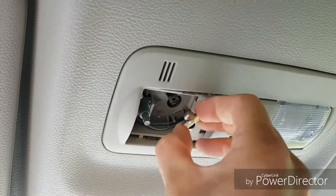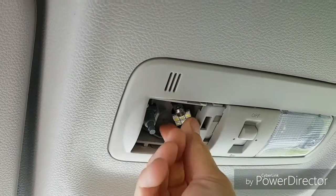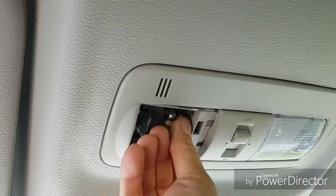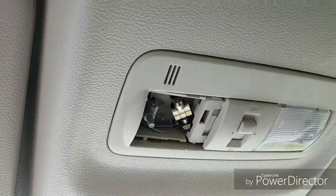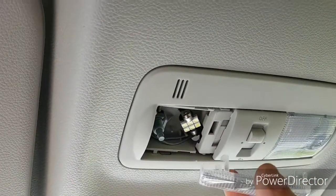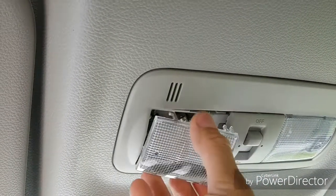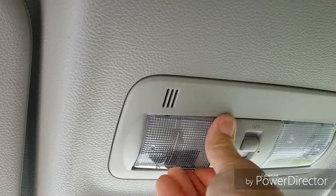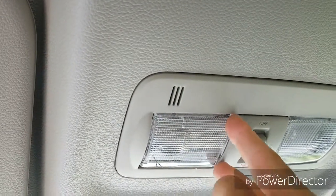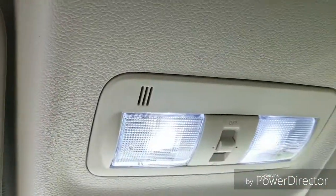That's right. So simply reinsert the festoon bulb, angle it basically flat like that. Yeah, it's working. There you go. Then there's these little hooked tangs. They kind of slip in over a plastic stopper at the end, up and in. Then you just pop the corners back in flush, check its operation, and away you go.